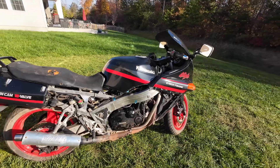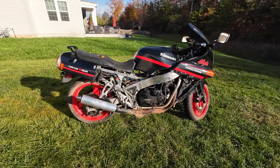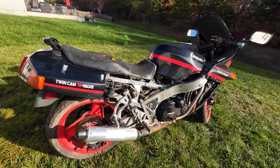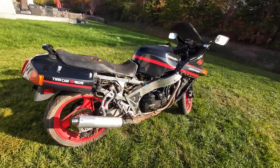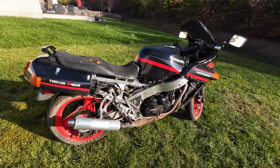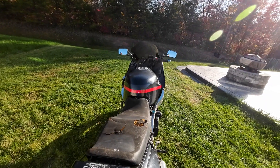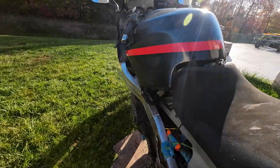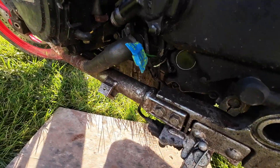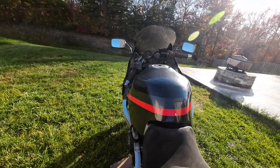Same old stuff — the fuel tank had rusted out, so this is a replacement tank. Brakes were seized, fuel system issues. These bikes have a problem with the starter clutch that ends up blowing up the real clutch, a lot of wiring issues. As the bike sat at this angle, the gas tank started to leak, which killed the alternator, and then the side stand switch. That was a lot of fun to figure out — it would not turn on, it was just dead.